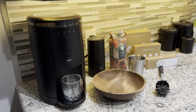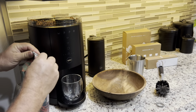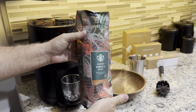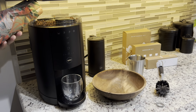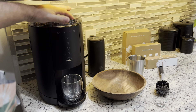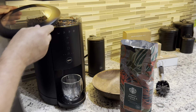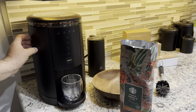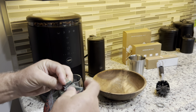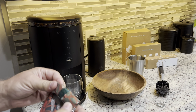Here's my routine. Every morning I'm going to add some beans because I'm a little bit low, and my first recommendation is do not fill the beans all the way up. If you fill them too much — and I never change the coffee, I love this stuff, siren blend, it's all I use — you can just fill this up, and that's about all I fill it. This whole area here is empty. When I first got it, I filled it all the way, and what happens if you fill it too much, it'll pull the beans down and they'll get stuck. So by not filling it all the way, that fixed that. Also, if you like to switch out your coffee types, you don't want to fill it all the way because I've never emptied it, but I would imagine it's a pain to empty.